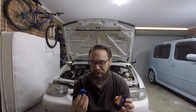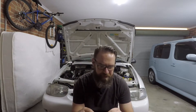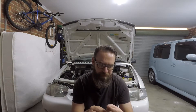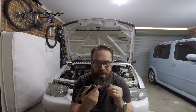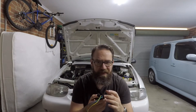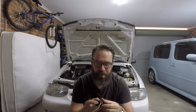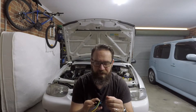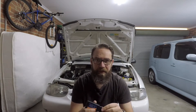I also have a newer, more slimline adapter and that one doesn't actually work with this car. For the wiring, I just had some wires lying around and crimped small terminals on them to make it easier to connect. One thing that confused me when looking up pinouts online: they generally show the female connector, but this is the male connector, so all the pins are going to be reversed when you're looking at it. Make sure you get those pins the right way around — the common power pin is on the very bottom right corner, so as long as that matches up you should be able to figure out the rest.